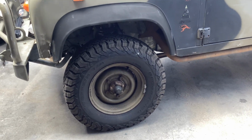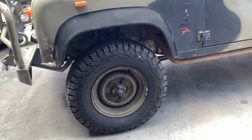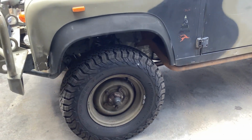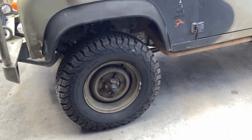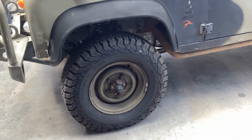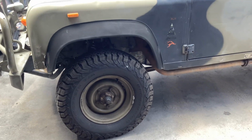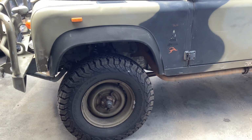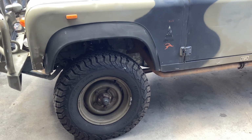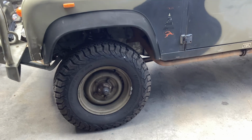So these are all 2 inches above standard ride height, which, like I said, on a Perentie is only about an inch, I guess. So it's not ridiculous. It'll still pass roadworthy if the vehicle needs it. On the front, I've got the heaviest load coils. Terrafirma, I think, have changed some of their wording to constant load or medium load, but I've just called them the heaviest load, medium load or light load.